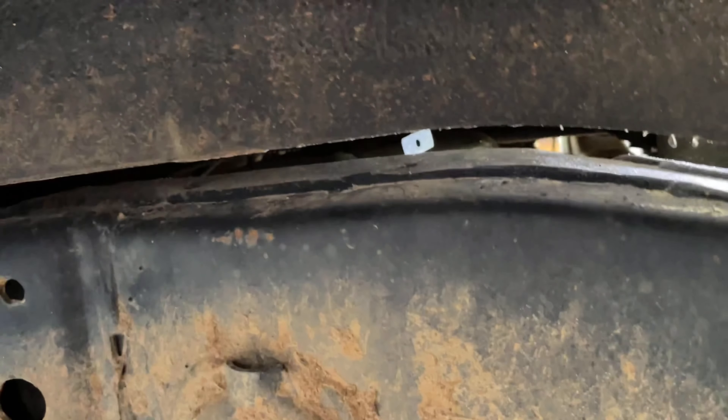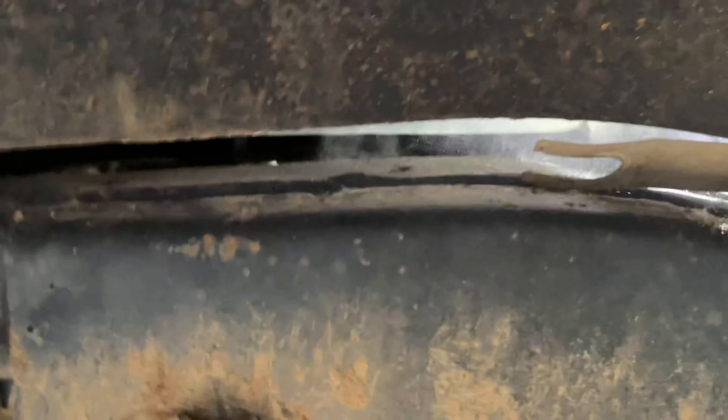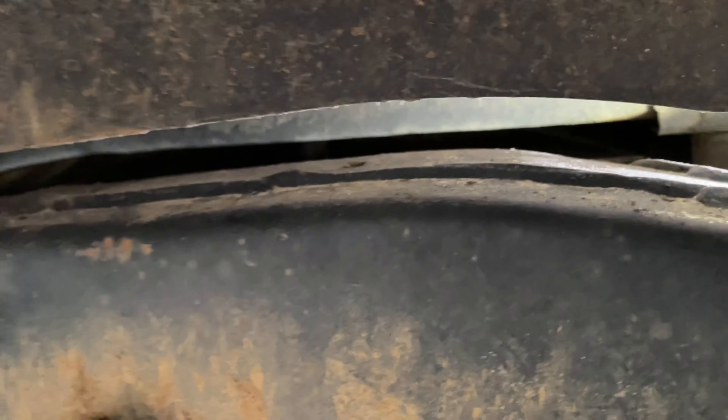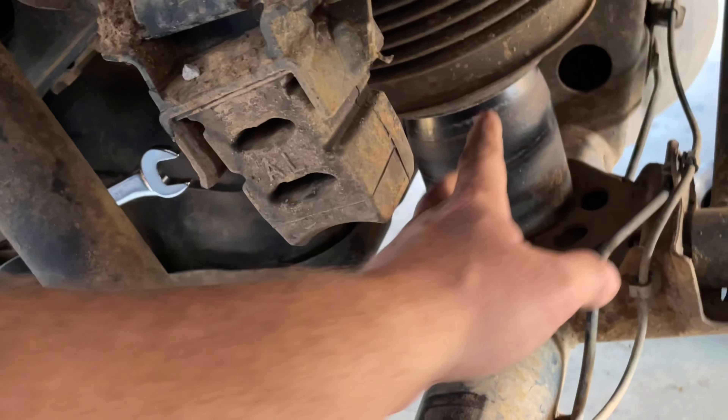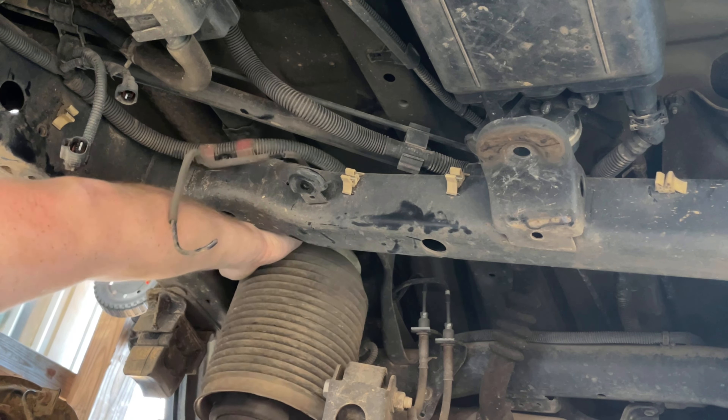A little bit from the side we come in here — there's your clip. I'm going to reach in there. A good wire hanger, if you can see. When I get this wire hanger, let it pull, and out comes the retainer clip. That's all that's really holding in the top of your spring. So now that it's gone, I'm going to get this straight out of the way and I'll disconnect the airline from the top of the air spring and you'll be good to go. That spring should come right on out, now that I've gotten all the air out.